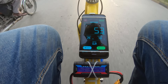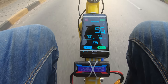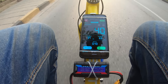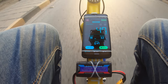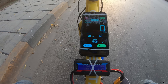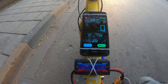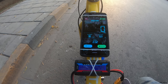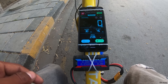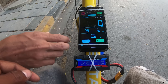The maximum speed we were able to take this bike to is around 70 km/h compensating for the speedometer error, and still there is a lot more left on the throttle. To our guess, it can easily touch 85 km/h of top speed. We did a 2 km lap with aggressive throttle, averaging around 40 km/h, and ended up consuming 23 watts per kilometer — giving us a range of nearly 66 km on a single charge with this 1.5 kWh battery pack. We did the same 2 km lap with moderate throttle averaging 30 km/h, consuming 15 watts per kilometer, providing a range of 100 km on a single charge.